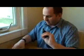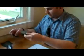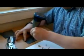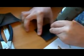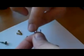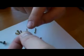There you go. And if you look now, the head of the screw, of the nail, is nice and flat. It's a little bit rough, maybe. In that case, we can use a little bit finer sandpaper, like 400. Yeah, now you can see it's a nice polished surface. I'm going to do a final touch with 800 and call it good. Okay. Now our screw is good, it's ready to be a button for original size. And you can see right now the nail looks the same as the other one which I did before. That's ready to be a button.